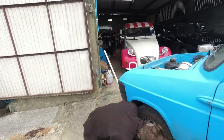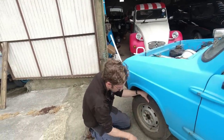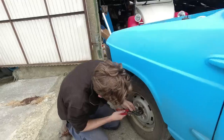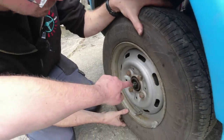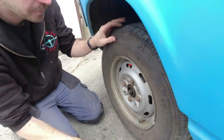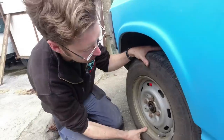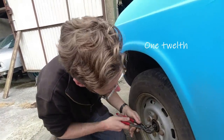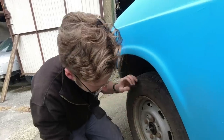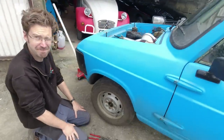We'll nip this one up a touch; the other side I think is going to be okay. I'll be curious to back the other side off actually and re-tighten it, just in case it's a touch too tight - it's never good either way. Obviously you don't do it as tight as you can get it, or you just destroy your wheel bearing. You've got two holes - one split pin hole goes straight down and one that goes across, so you get a sixteenth of a turn adjustment. You can see the hole - we're no longer lined up with that one but we are lined up horizontally. We've gone up one sixteenth of a turn, just a little bit. Lovely, so split pin it - I'll see if I can find one.